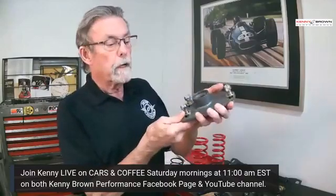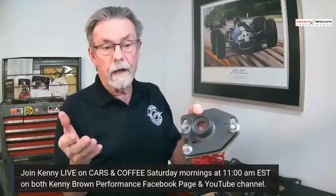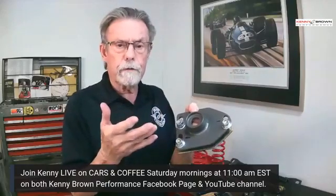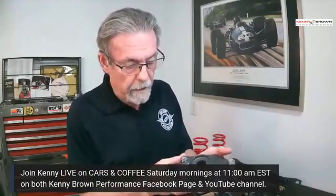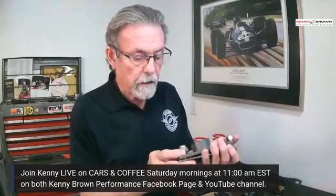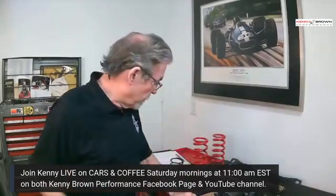So anyway, you make that mark, and then you go to the track and you drop it all the way in. You put in all the negative camber it will take, and then, as we've talked before, you start dialing the camber out based off of your tire temperatures, which are really critical. You just kind of back it up, and when you get finished, just put it back to the street setup and drive home. That way you don't have to get the car realigned every time you go.